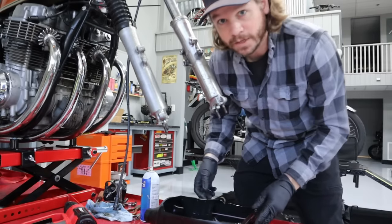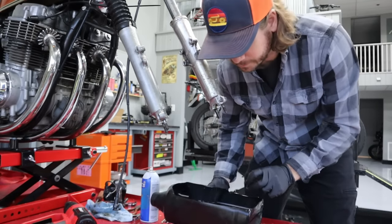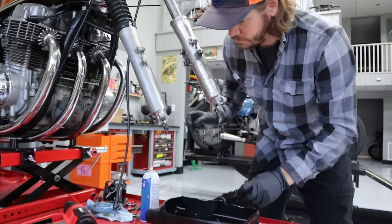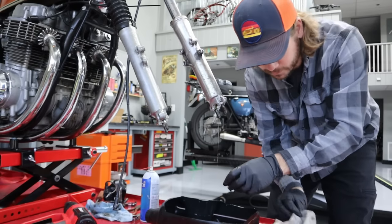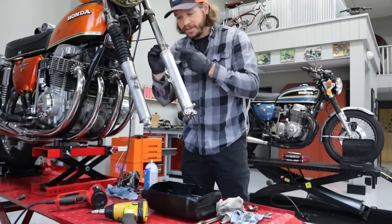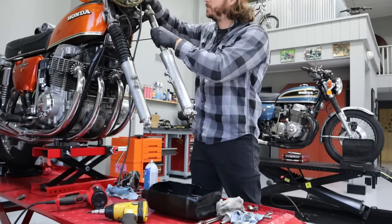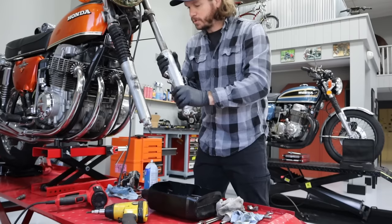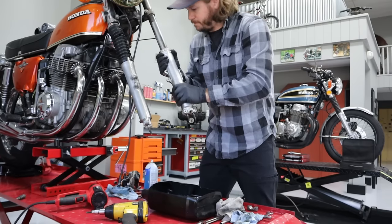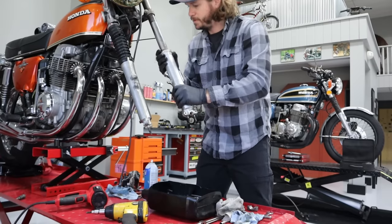I mean, the only logical place that the bolt can fall is in the drip tray. That's okay. As long as the fluid ends up there, we're happy. I've already taken the C-clip off the top. I had to fight it for a while, but I have this thing clamped into the fork just to give me some more leverage. Now we can slide hammer this thing apart.